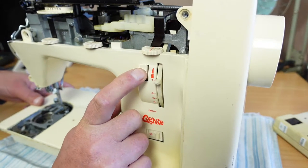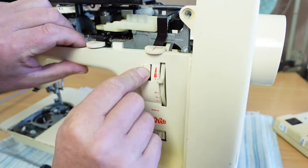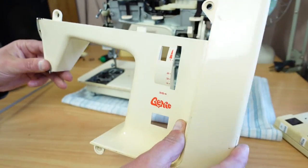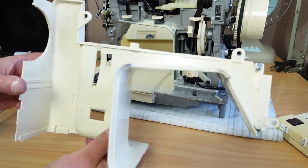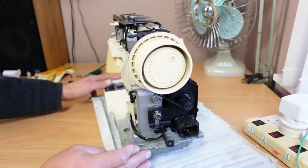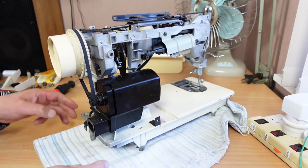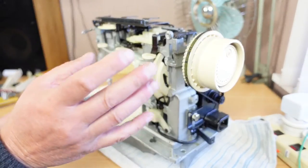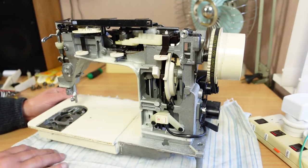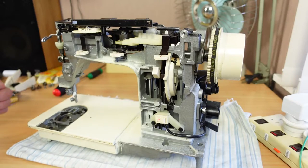Just need to make sure the cover comes up and over the reversing lever, holding that in while getting it over the top. The cover just lifts off like that. That's pretty much it as far as removing the covers — it's all reasonably accessible now for servicing. The belt tension might be a little bit loose — I'll show you how to adjust that. Let's get the compressor in and just blow the machine out. I'm going to blow the lint, dust, and grime out and then lubricate the machine.